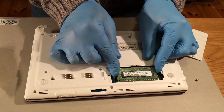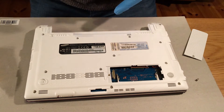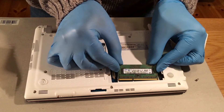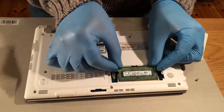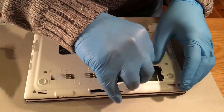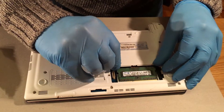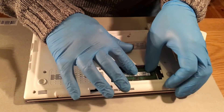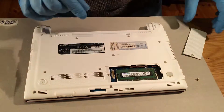I'm going to increase that. There are two little clips on the side — the RAM will slide back. Now the 2 gig of RAM goes in: slide it in, and it must engage and then click into place.